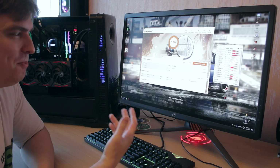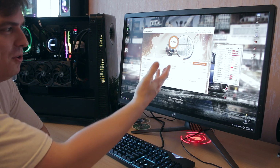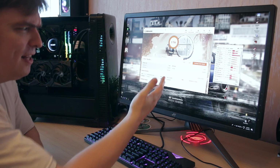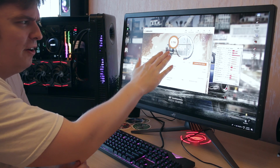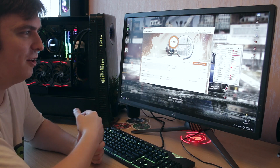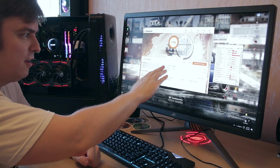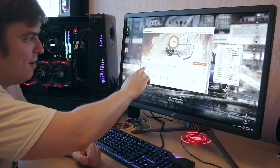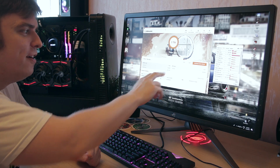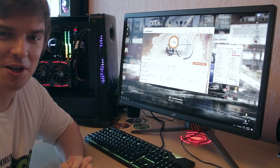Alright, so the Time Spy benchmark finished here, and 5,786 points, which is a totally fine score, I would say, for a 1070. Because a 1080 Ti would get about 9,900 to 10,000 points, which is about 30 to 40% slower, right? And I guess the GPU score is worth mentioning here. It's 5,858 points with GPU test 1 at 37 frames per second and GPU test 2 at 33 frames per second. So yeah, that's concluding my benchmarking here.